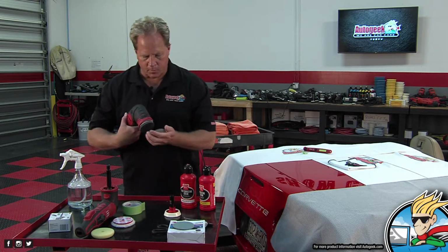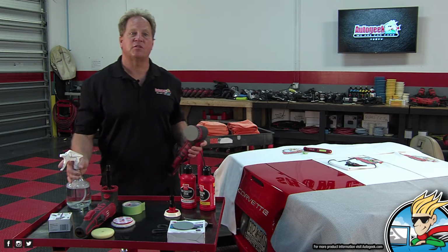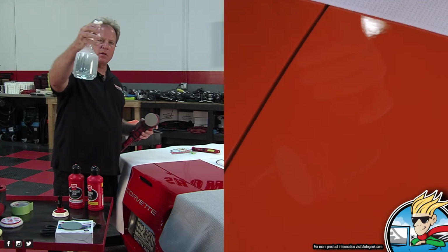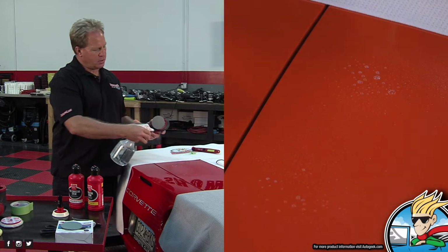Okay, so first thing I'm going to do is put my 3,000 disc on here. I think I'll just try 2 or 3 passes and then we'll wipe off and see if the imprints really show up on camera. All right, let me get soapy water, just a little bit of car wash soap and some clean water for a clean sanding supply. I mix a little water on there.